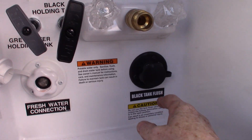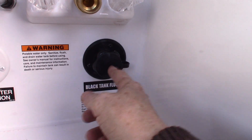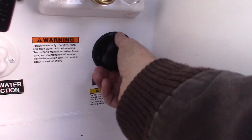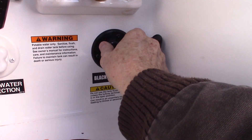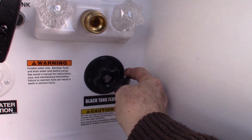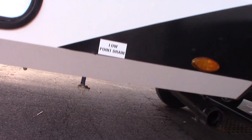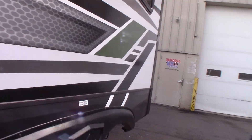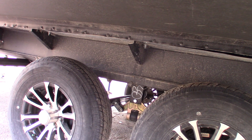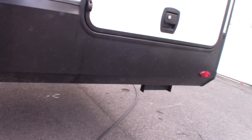The main thing to remember: when you're dumping your black tank, leave the valve open before you turn the hose on. Put the hose at the dump station, make sure it's open, and turn it on — it'll flush out your black tank and clean off the sensors. Low point drains are right there. Fresh water drain is just behind the front axle.